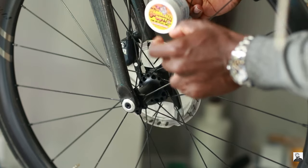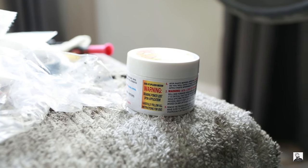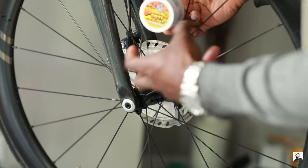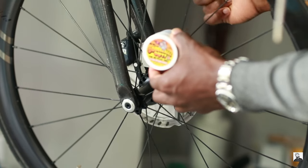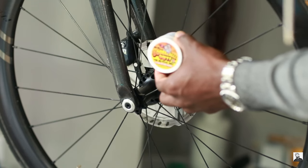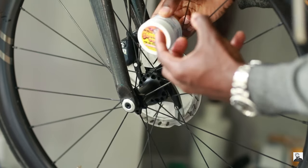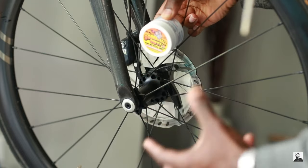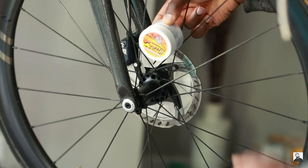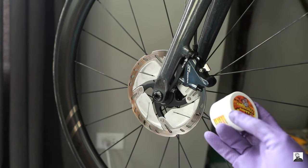The directions say to stir up the paste before you apply it, and don't apply too much. They also recommend doing only one wheel at a time because you'll lose up to 80% of braking force during the application and bedding process. Once done, wipe down the rotor and pad surfaces using isopropyl alcohol. I already know this stuff works because I've done it to the rear disc brakes and they work perfectly with no squealing.